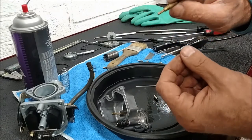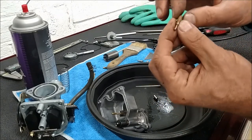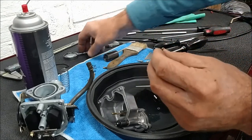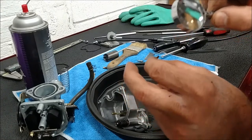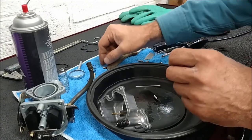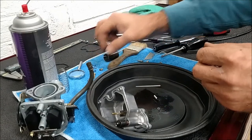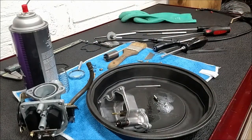The pilot jet has a tiny hole in it, only about 0.4 millimeters maybe. We are going to have to examine that with a magnifying glass to make sure that we see through a clear round hole - the needle, no clogs. Main jet also. Main jet is much larger. Let's get some gloves on and start cleaning.